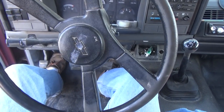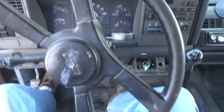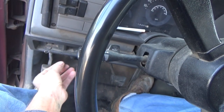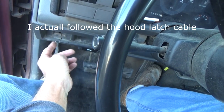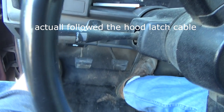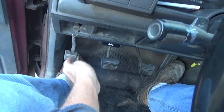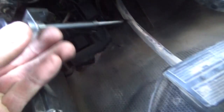So we'll look at that. We're in the truck — the key switch is right here, the gas is over here, and usually they always put the choke over on this side. I was looking for a way to put it in, and here's the emergency brake. I got a wire going to that — I'm going to put it over on this side, it's going to follow the emergency brake cable. I'm going to drill the hole in there, down at the bottom, go right through and around. I got it going through the firewall.